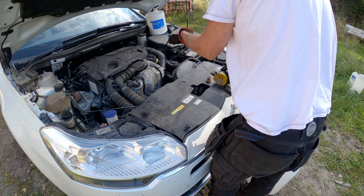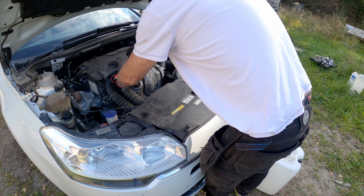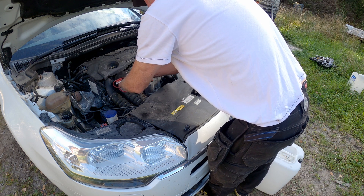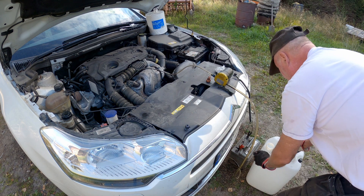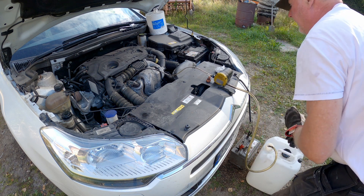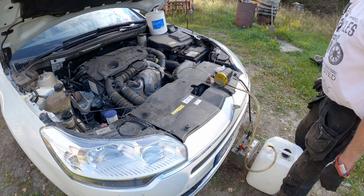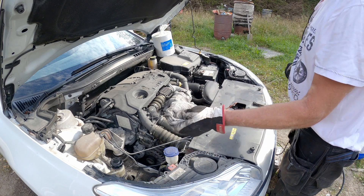Normally I would use the battery in the car, but I happened to use this pump on my tractor just a few hours ago so the battery was standing there. I pushed the hose down about five centimeters deeper than the dipstick is long. Then I use an empty can so I can see how much oil I got out from the engine. It takes about 10 minutes to suck out the oil with this pump, but I will spare us that because it makes a terrible noise.